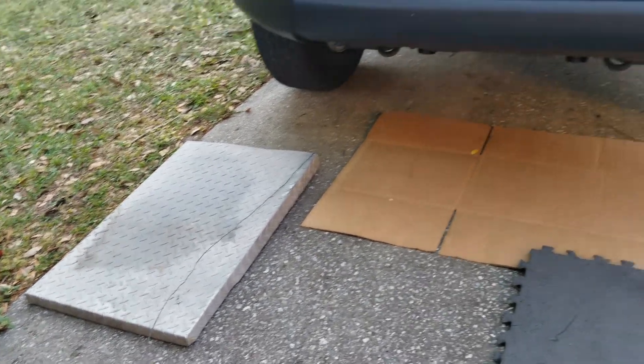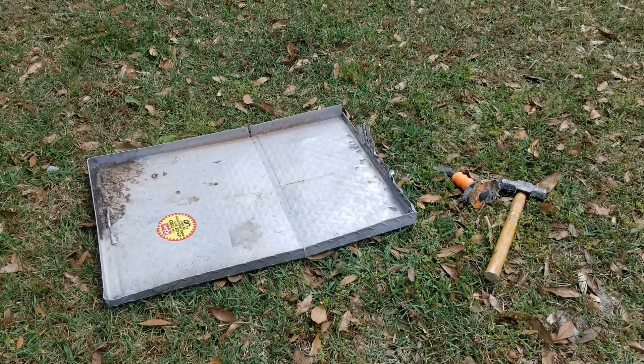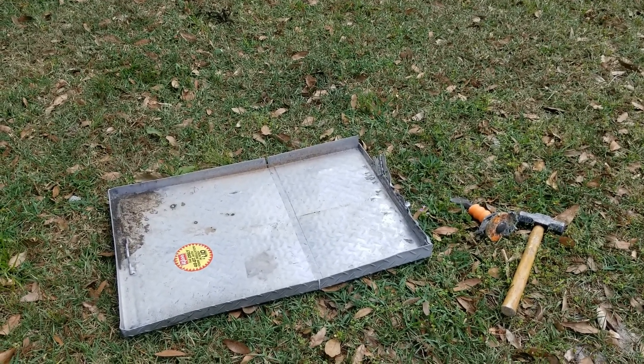This is one of the doors, and it just happened to be the right width to cover the center part of the truck. Let me show you how I'm going about creating a crease so that I can bend the panel to shape it to the bottom of the truck.